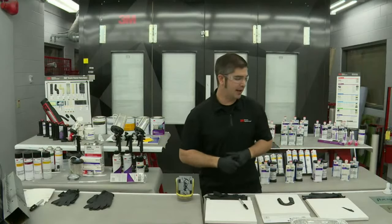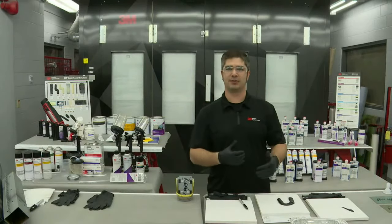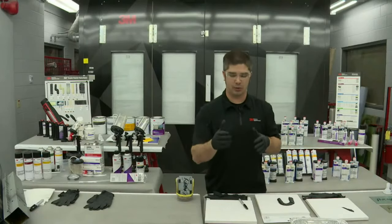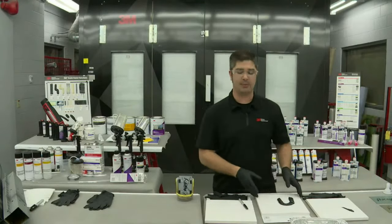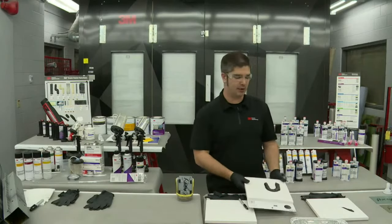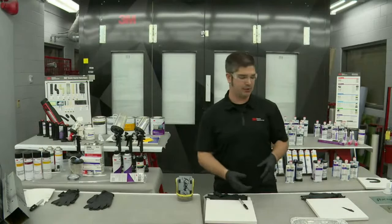My mistake. This is where some confusion comes into the industry, because technicians will say, okay, I hear your messaging. I want to prevent corrosion, so I'm not putting seam sealers over bare metal, but I'm using them over a primer. And then the next part of the conversation is really, what primers are we putting them on, and what primers are we putting them over?